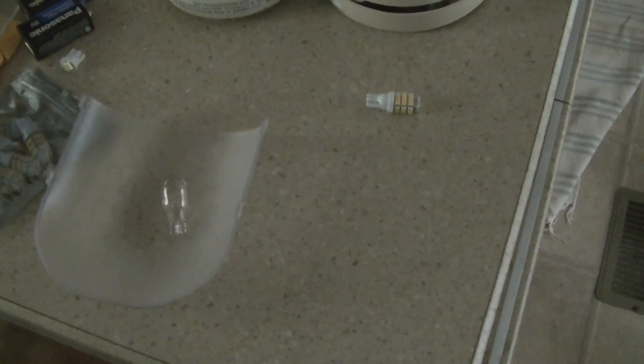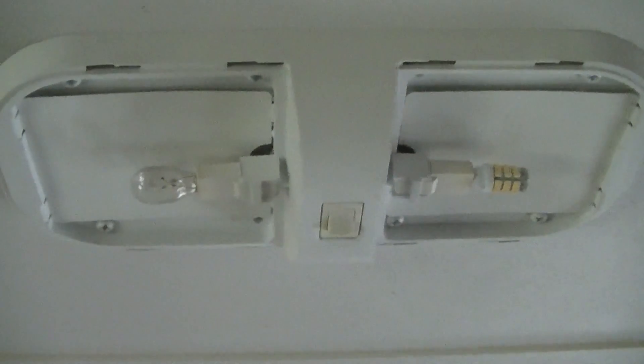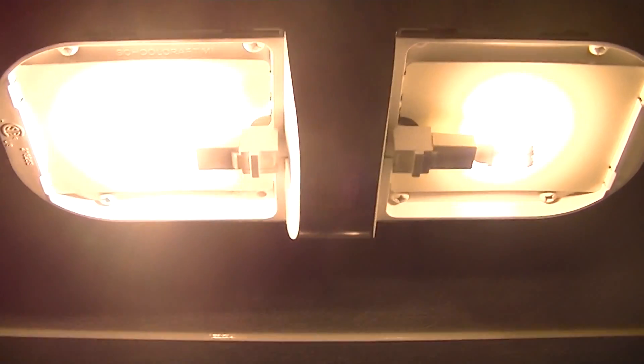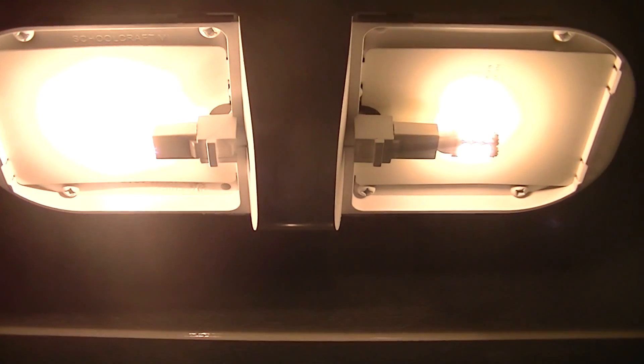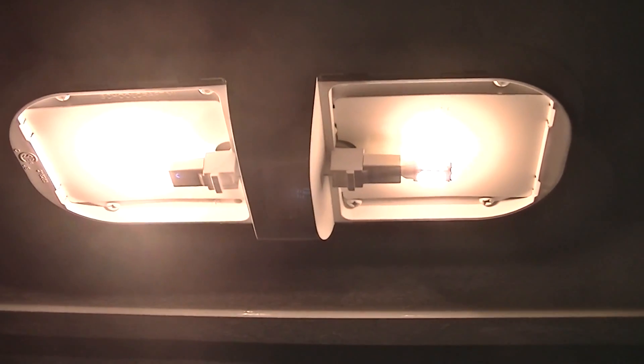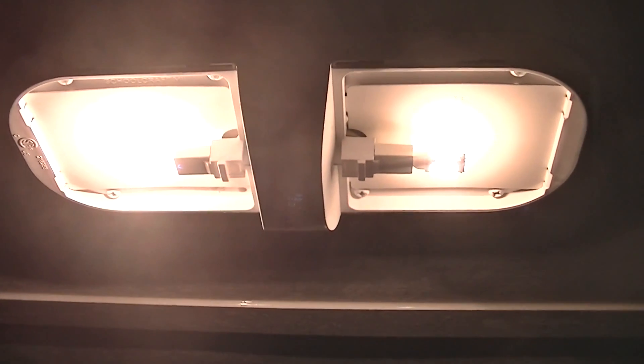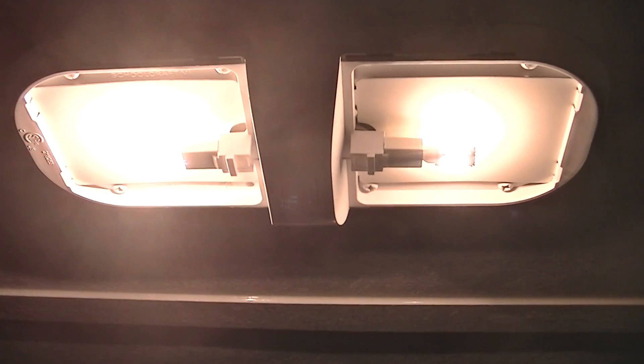One of the last things I did after replacing the power supply was noticing that when I have three or more lights on in the trailer I usually hear the fan go on. So to put a little less load on it, I bought some LED replacement bulbs. I'm going to turn them on and show you — the one on the left is just a standard incandescent, while the one on the right is an LED. It seems a little less bright but hopefully it'll be a lot less load on the trailer and the power supply.